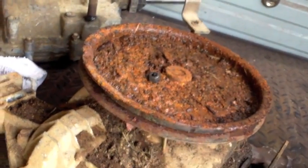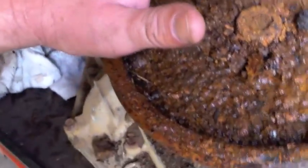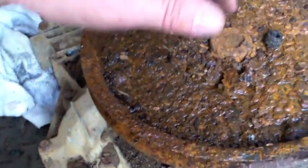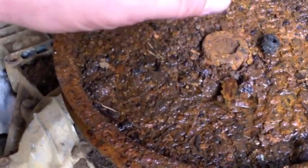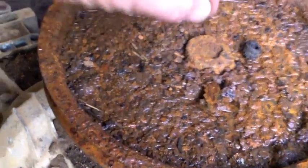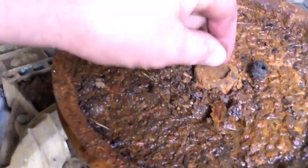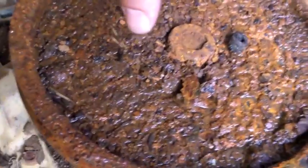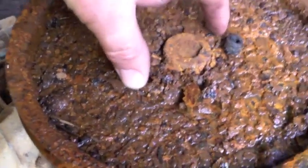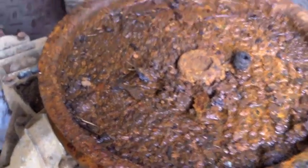Today's video is how to pull it off. There are a lot of different ways you can do it: lubricate it, heat it, tap it — sometimes that works. Redneck Computer Geek does a really good way of putting candle wax onto it, heating it up to where it becomes liquid, letting it seep down in, then letting it cool off. The candle wax expands, breaks the rust and the connection, and actually lubricates it so you can tap it out. I've also seen Mike Mayeron drill two holes in it, use bolts and nuts with a puller, and pull it out.